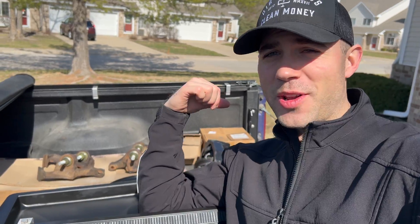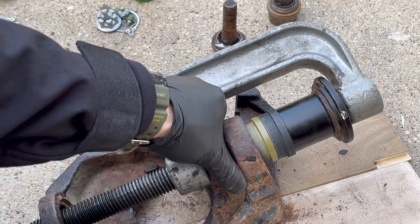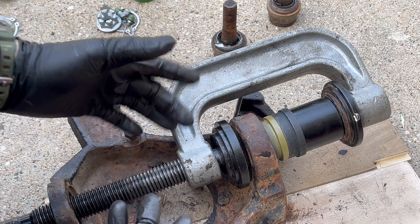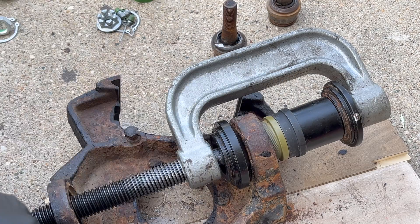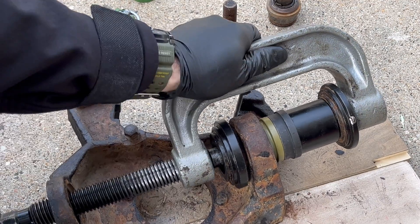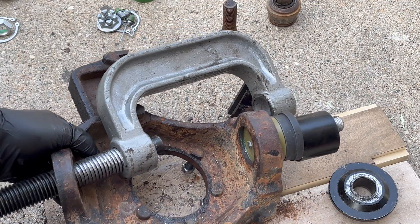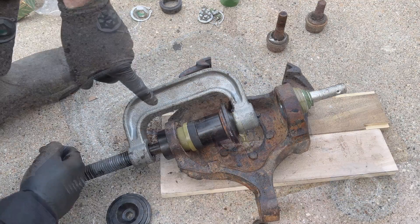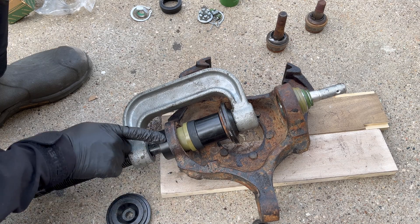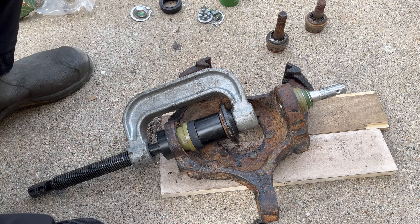Here's my press setup. I have a hat down here, one up here, a sleeve, and that installation ring. I'll have to swap out the top piece once it's mostly seated, then switch to something that allows the ball joint to come out the bottom as usual. Time to start cranking down. It bottomed out as expected on that adapter, so time to swap. I've queued up the lower ball joint, hat, sleeve, that installation adapter, and a recessed cap. Time to press it in.